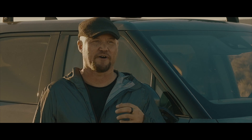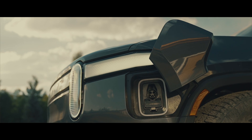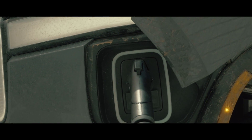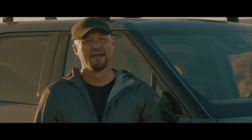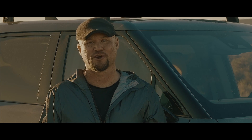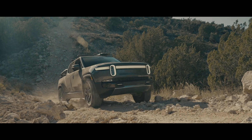What I do notice is that they're a new car company, so there are little things that are maybe more complex than they need to be. For example, the charging port uses a very complex motor to swing open the door — when we got into a lot of mud, I couldn't get it to open until I cleaned the surface. If you had a little trail damage to that fender, you might not be able to open the charge port door; a simple push-and-open hinge would be better. The center console also has a fairly complex solenoid — sometimes it doesn't open, sometimes it does. I'd love to see a simple mechanical catch. These are little things I'm sure will be corrected in future editions.